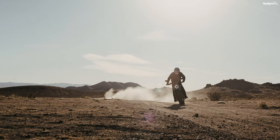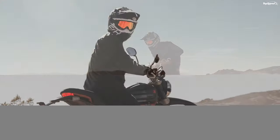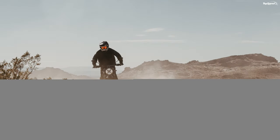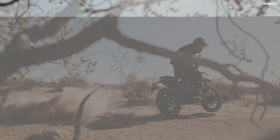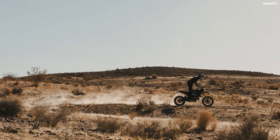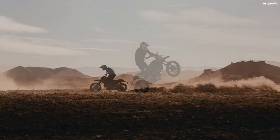The L-twin engine, or 90-degree V-twin if you prefer, comes quite oversquare with an 88mm bore and 66mm stroke for a total displacement of 803cc. The 11-to-1 compression ratio falls in the middle of the range and will tolerate 91-octane fuel. Induction control falls to the 50mm throttle body with electronic fuel delivery that partners with an exhaust catalyzer and lambda probes to meet Euro 5 emission standards. Power output is claimed at 73 horsepower at 8,250 rpm with 48.8 lb-ft of torque at 5,750 rpm. It flows through a slip-and-assist clutch that makes for a light pull weight at the lever and adds a layer of traction protection by preventing excessive back torque from developing in the drivetrain.